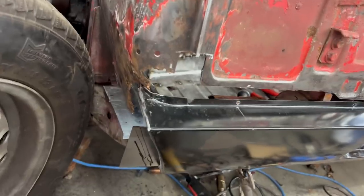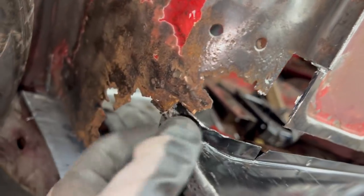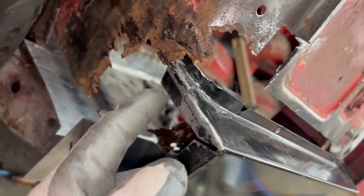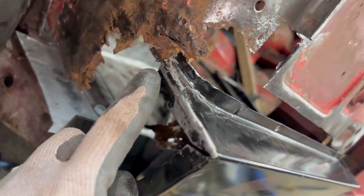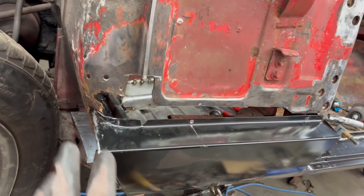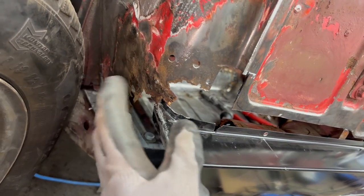I think I'm gonna have to rebuild the bulkhead first, or at least part of it, in order to be able to finish this inside. Oh my god this corner is a nightmare. Here you can see how the bulkhead makes a big step in order to accept this, and that's how it was — I didn't make that. I think I'm gonna have to flatten that. I unbent this flange and I bent it a little bit higher but looks like I have to go a lot more — I need to go to where the black line is. That's where I need to bend it. And also I have to unbend the top flange and make it wider a little bit. So yeah, that's a corner of hell here. I'm gonna take the seal out again, do this work on this corner, and then bring it back and see what we can do about the bulkhead.